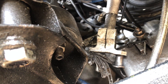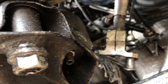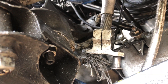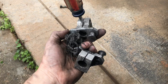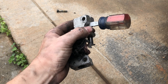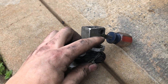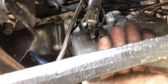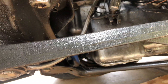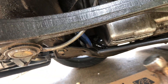I think I'm going to have to stick a screwdriver into the slit right there to spread it out a little bit so I can hammer it off easier. This is a tedious process and it's tiring laying underneath the car. So I got a little carried away — I got it taken off. I stuck a fat screwdriver in there to spread it out, then started hammering down. I moved the shaft in between this control arm and the oil pan and just hammered it down with the circular part of the hammer.